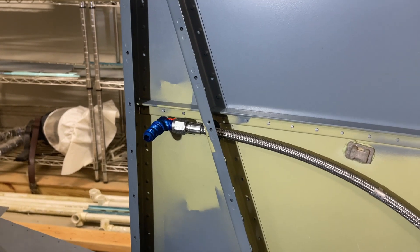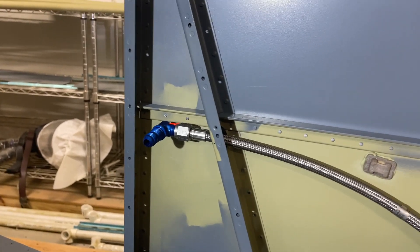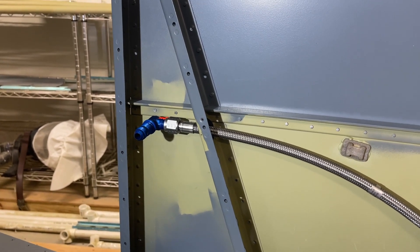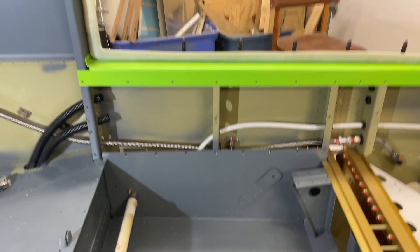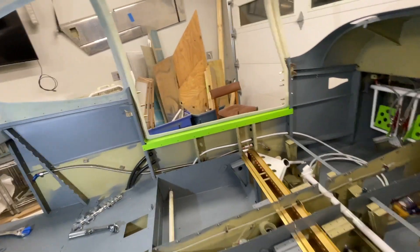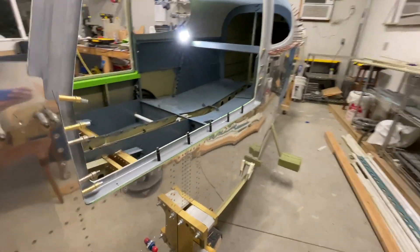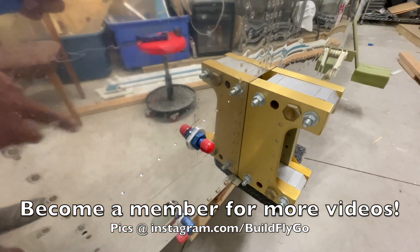Instead of riveting that in place, I just put nut plates, and it's just going to be capped off, because I haven't decided which ferry tank system I'm going to use or any of the above. It's probably going to be something like a turtle pack. But I figured an AN fitting right there is easy enough to retrofit to whatever I need in the future — to plug a hose in, to plug a quick disconnect, whatever I need. Easy enough. And it's an AN6. I decided to go with a Dash 6 size hose, mostly because why not — I could have done a 4, and then it might take a little bit longer to transfer the fuel. The 6 doesn't hurt me at all; there's no downside. And here's the fitting coming out the side, and it just gets plumbed into the fuel tank.